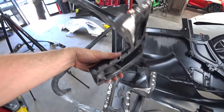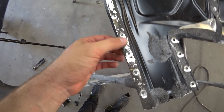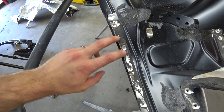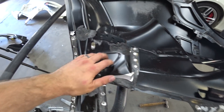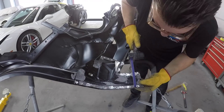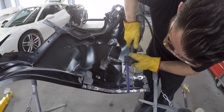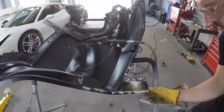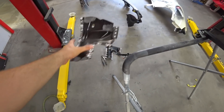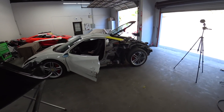The first section came off, so now I gotta remove this plate and we're good to go. A couple spot welds are holding, so I'll drill this out from this side so it doesn't damage the good side — this piece is going to trash. I removed those two pieces — this is garbage, same with this piece, we don't need it. Everything came out nice and clean, so we can start test fitting the quarter panel.